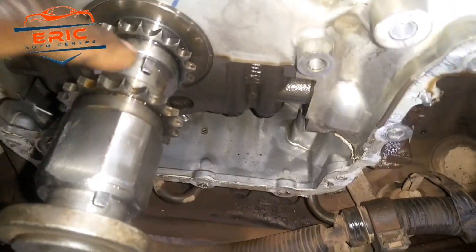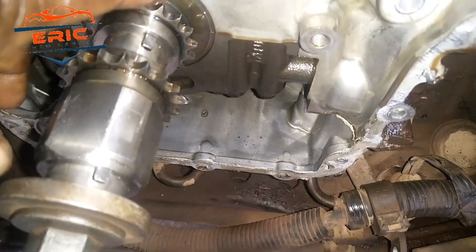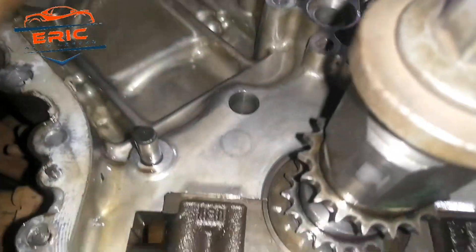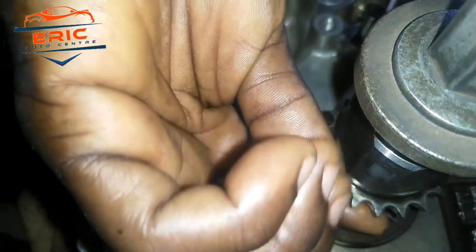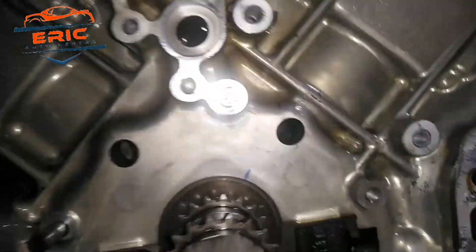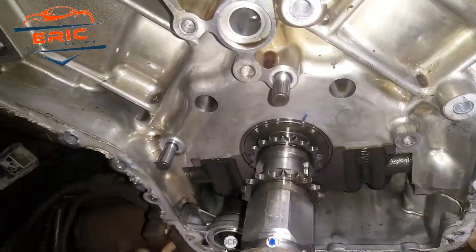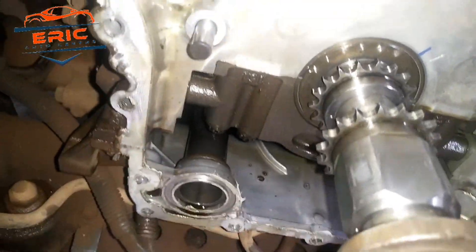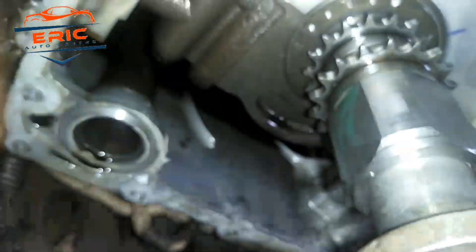This thing confuses people all the time. Down there you can see there is a key here but there is no printed mark. I have figured out how to get this mark, which is the right mark. The timing key is at the bottom here. I will show you — as you can see, the key is at the down here. This is where the chain will align for you to see. Let me turn it so that you can see it clearly. We are turning it off TDC. And this is the mark. You can see there is a deep mark here, and also there is another one here. This is how you are going to align it. Take note about that.